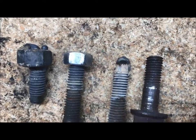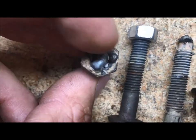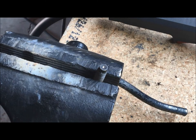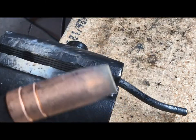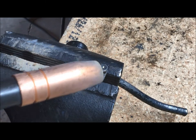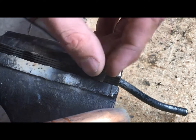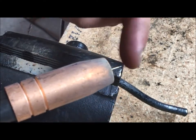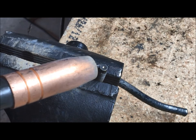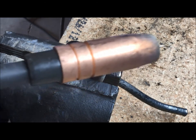In this series, this is the broken stud, this is where I've welded a slag pile on top of the stud. The next series will be putting the bolt over the slag pile and then welding this bolt to that slag pile. For this first initial weld, get your lead out there a little bit, just touching the end of the stud basically where this punch is, and build up a hot little slag pile that will mate up to the stud. Have your wire feed set to slip a nut on. Make contact and hold it there for about two or three seconds, because if you just tap it the weld won't be strong enough and it'll just break off.